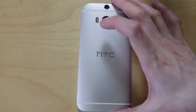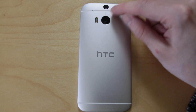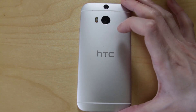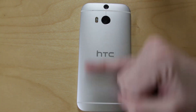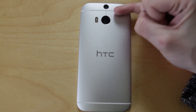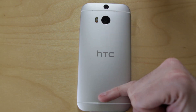With the HTC One, the heat build-up is quite excellent — by excellent I mean it doesn't generate incredible hot spots in one corner. The heat is much more evenly distributed down the casing. A lot of this comes from the aluminium case acting like a heatsink in its own right. There may also be a copper layer or another metal layer inside acting as a heat spreader, moving the heat away from the CPU-GPU package and helping to spread it down the case.